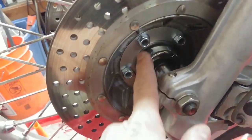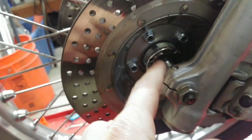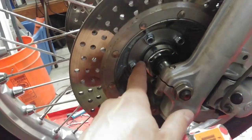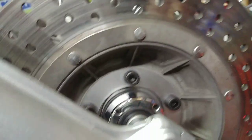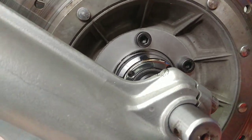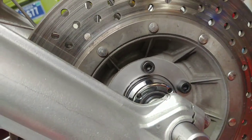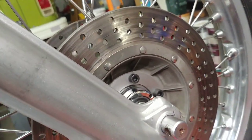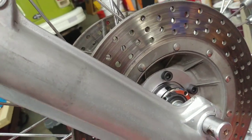You guys are always very observant — you probably noticed the bolts are not long enough. These are bolts from a hardware store just to put the rotor on temporarily; I'm not riding it. I have the original BMW part-number-correct bolts and nuts on order. These hardware store ones are 12.9 grade — on metric bolts you have grades 4.8, 8.8, 10.9, and 12.9. Unfortunately I bought the wrong length, so there will be another care package from Max BMW with the correct bolts and nuts.